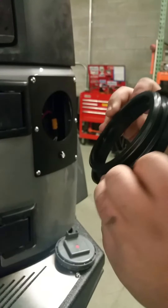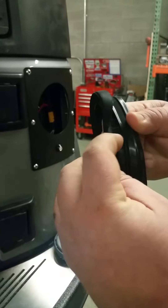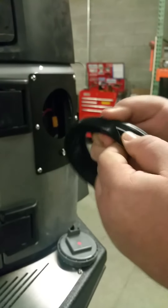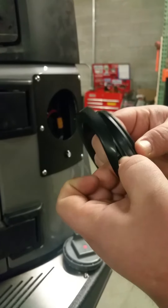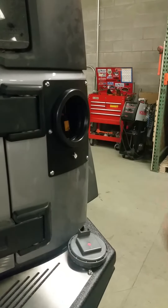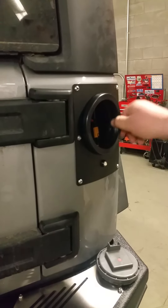Now I'm going to show you the grommet. Since these lights are typically installed on a flat surface, they only make this little lip big enough for pretty much a flat surface. When it's on a radius, it kind of messes it up. This real thick part of rubber right here is what prevents the light from being pushed in. You can install it like that — this is how we used to always do it and it works fine — it's just harder because you're fighting that big lip of rubber.